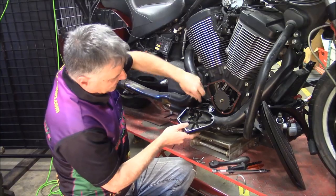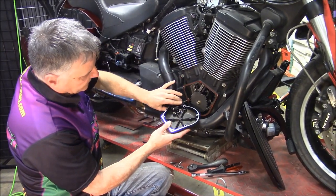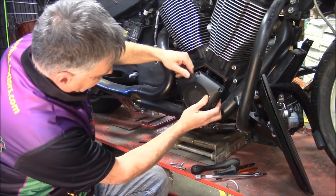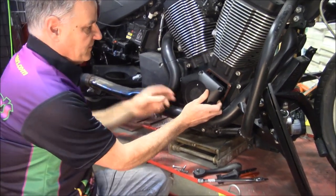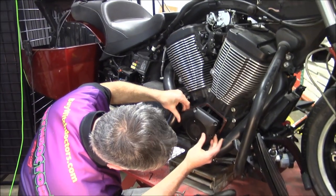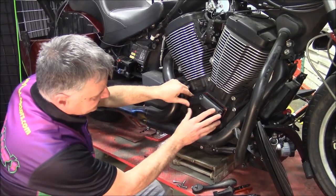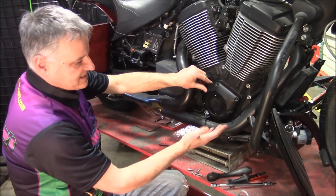So we just use it like that, and then we put the cam cover back on. Just make sure you put that wire in there so it won't leak. You just simply go over top of these studs. Just put that on and get the wire back in — and now you can see it holds everything right in place so the gasket doesn't fall out.